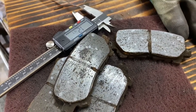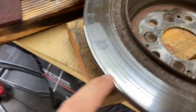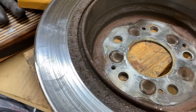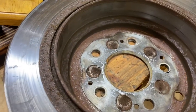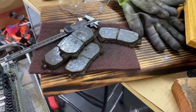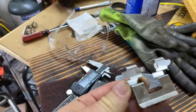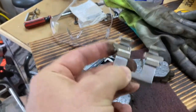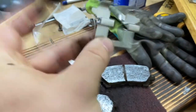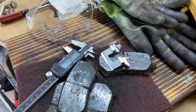If you have access to a shop that can turn the rotors, you could probably get a little more life out of them. But if you don't, just go ahead and get new rotors and plan on replacing it all as a unit. One final thing: I said the kit didn't come with new hardware — that wasn't true, I just didn't find it initially. So I put the new hardware on the driver's side, but the old hardware on the passenger side cleaned up nice, so I didn't pull it all apart just to swap it. Thanks for watching.